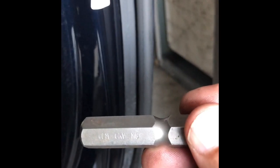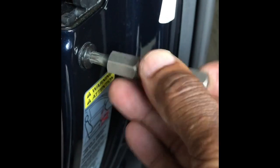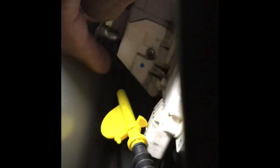It's these two bolts. What you're gonna need is an M8 — this type of tool to get this out. I'm gonna put a socket over top of this and get this out. Here's the cable for the door actuator. This bottom piece right here — you turn it sideways to come out through this little hole up here. You take this plastic piece like this, twist it — see this little notch? It's notched underneath, so you twist it and it slips out of this little groove.